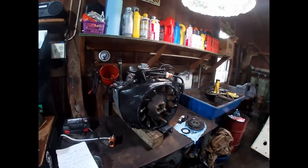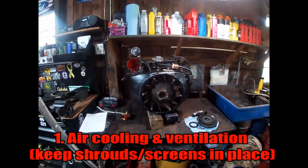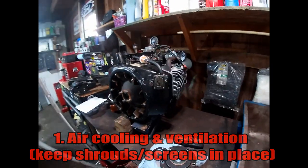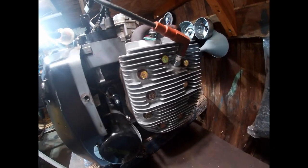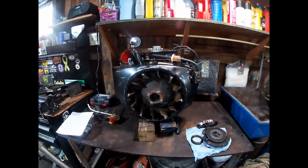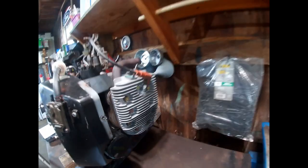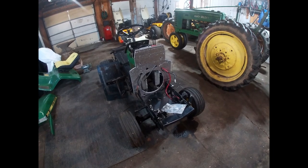The first thing to take into consideration is that these are air-cooled engines. They rely on cool air coming in through the intake through the flywheel blower, directed around the flywheel across the cylinder heads through the cooling fins, and then out the rear of the engine. Technically the flywheel side is the front of the engine, but in most garden tractors they're mounted backwards, which throws a lot of people off.